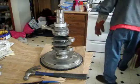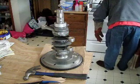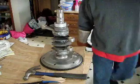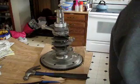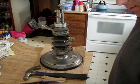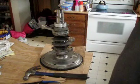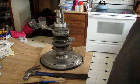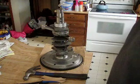So let it get heated up just a smidge here. Starting to heat up already. Usually you'll see a couple wisps of smoke off it when it's ready, and this gives me a good opportunity to clean the top of the stove when I'm done. After the gear goes on, you'll see me put the spacer on, and I'll heat up the gear for the distributor drive. That goes on next, then the snap ring, and then the top bearing.